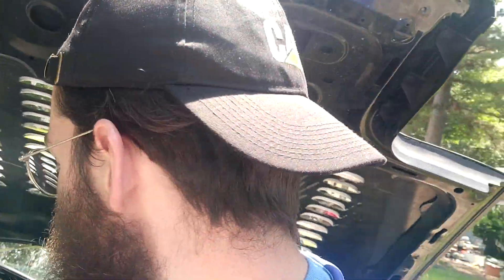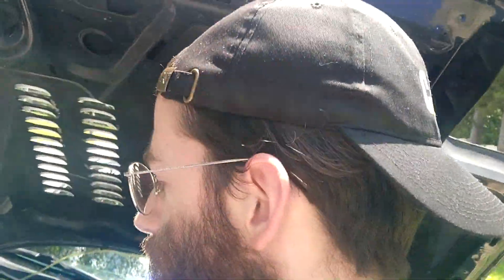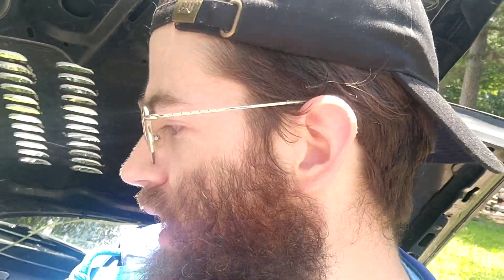This is totally plug-and-play so you could go back to the stock coil pack if these burn up. I've driven about 15 minutes on these and they didn't get hot. There are only a couple of people who have done this and none of them documented anything, but I haven't heard about them burning up. They got about as hot as the engine bay - they weren't electronically hot. I'll try to draw a wiring diagram in MS Paint since we did get the pins wrong, but you can use a multimeter to verify 12-volt and signal.